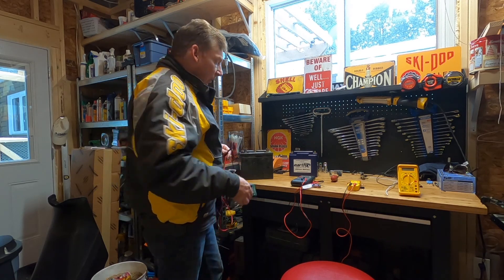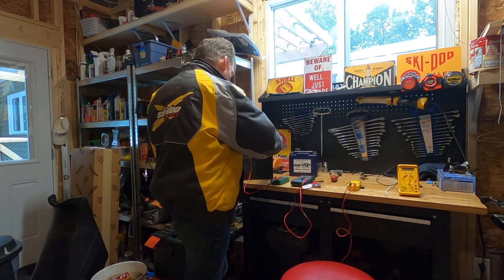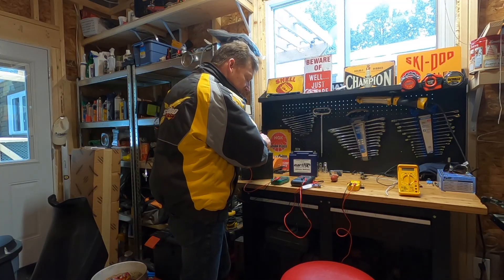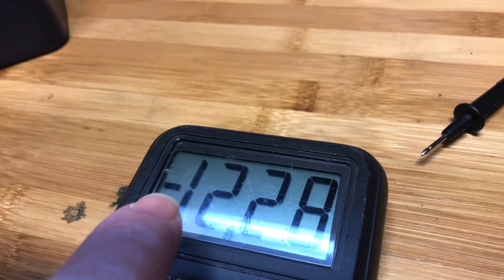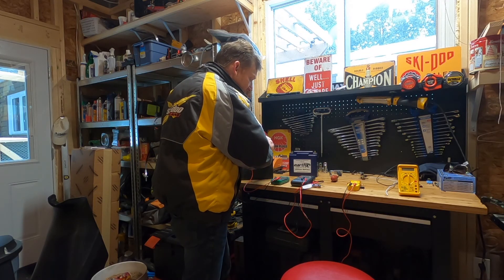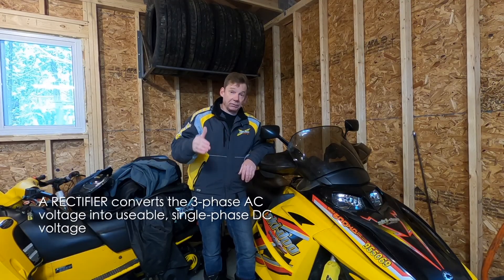The other cool thing with a digital multimeter: if I reverse my leads by mistake — red on negative, black on positive — it doesn't damage anything. It actually gives you a little negative on the display, telling me it's minus 12.59 volts, and that's actually handy. This Rev chassis has both AC and DC — it's got a battery it uses for electric start and fuel injection. Like the 670 has a stator that generates AC, but instead of a simple voltage regulator, it has a regulator rectifier that regulates the voltage and converts it to DC.